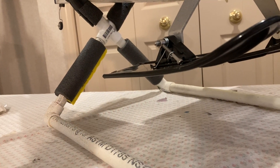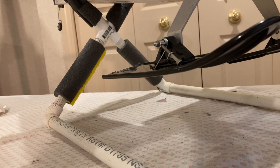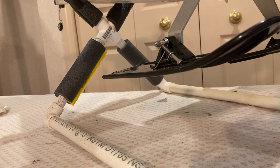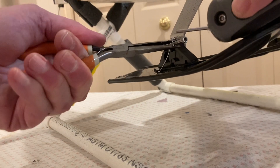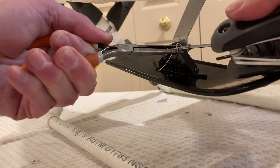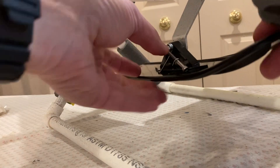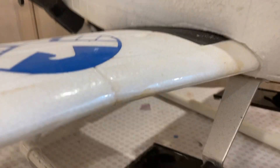Once that's done, you're going to take a hex wrench and adjust this — essentially a big grub screw — into the O-ring, and you're going to adjust the pitch of the ski. Most times if it's pretty tight, it'll stay pretty firm even when you're landing. And that's it — you're done. Just repeat for the other side.